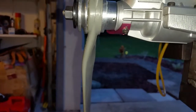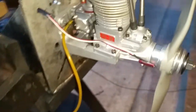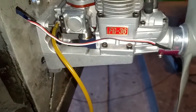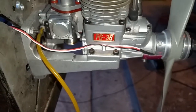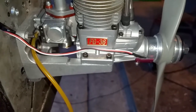You might have to work it a little bit to get the 30 degrees before top dead center — a little bit of filing here and there may be required. For those who have these ignitions and can no longer find them after so many years, we have the sensor adapter. Bill Carpenter had this for a very long time and when I took over I just made it more refined.